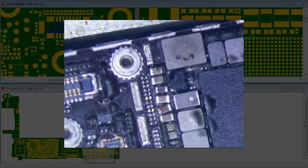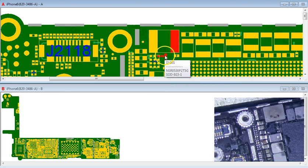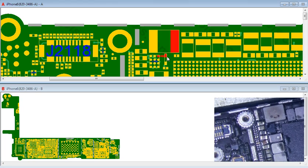Number two: check the coil. The coil goes from here to here. We can't get underneath the coil to test it, but we can stick a multimeter here and here and that will give us a reading on the coil. Put your multimeter in resistance mode and touch these two points. I'm getting 0.5 to 0.6 ohms right now. On a known good one, that is closer to 1 ohm. So just from looking at this, the coil is bad — I'm going to replace it.